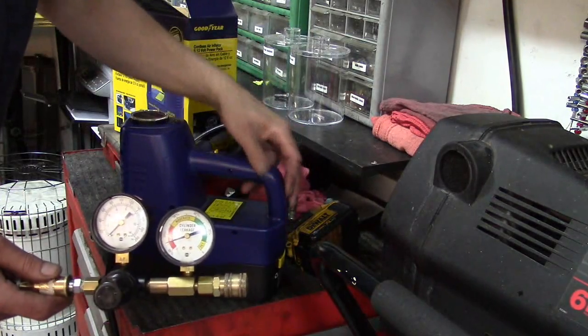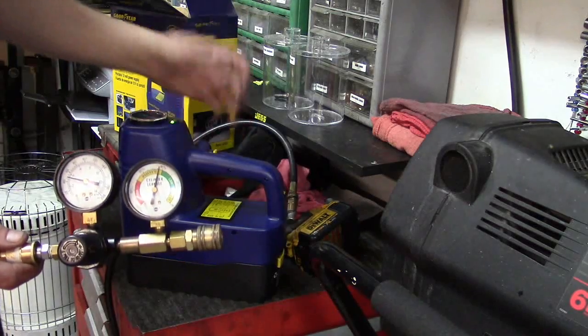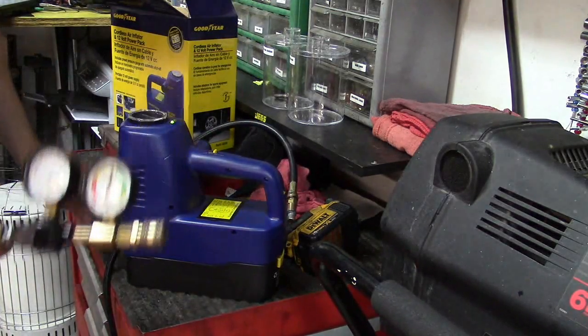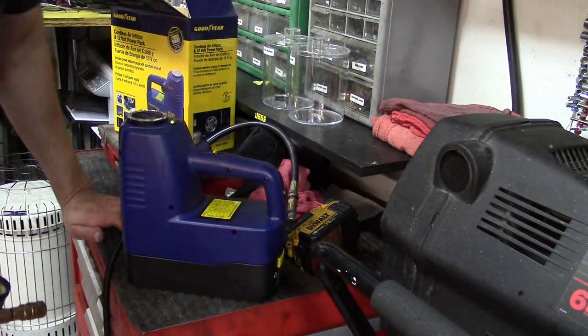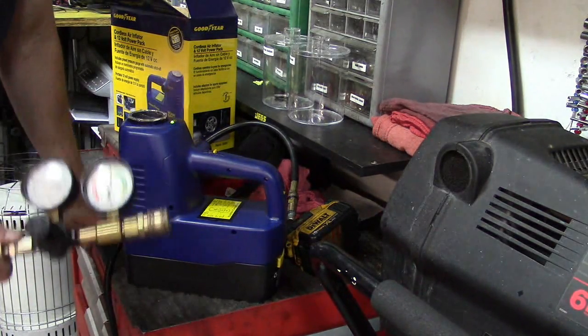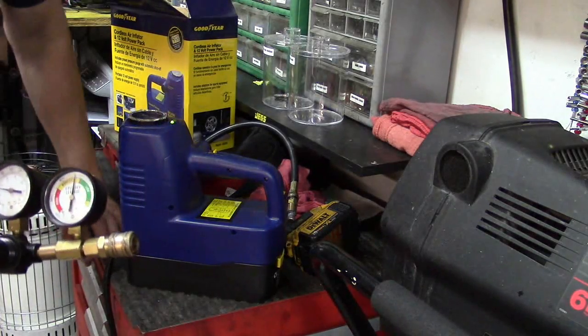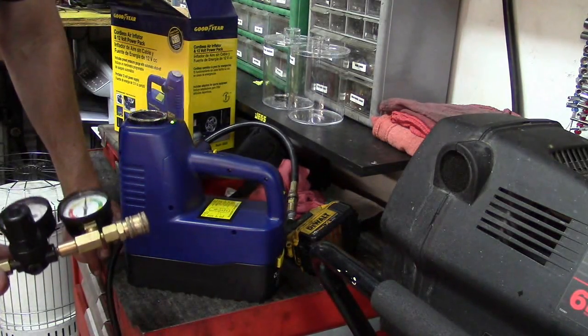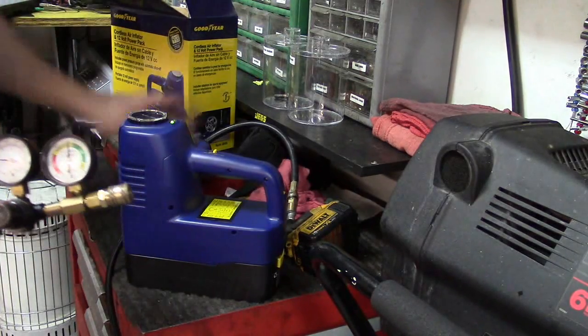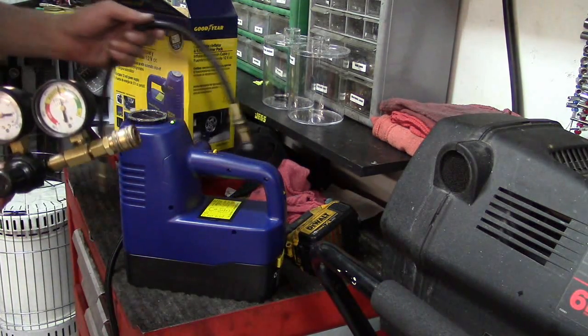It's a little bit noisy, and one of my concerns is that the noise will make it impossible to detect where the leak down is coming from — through the intake or through the exhaust. The cooling system would not be easy in a junkyard since there's no coolant in the radiator in the cars. So that may be a little bit of a limitation too, but let's go ahead and test it out and see how it works.